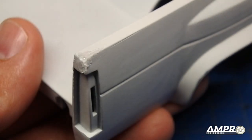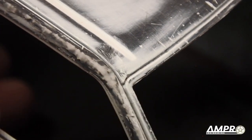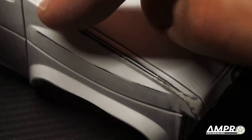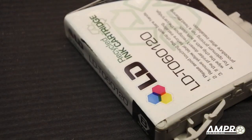We'll let this dry for a couple of days and then pick it back up and start sanding. You can kind of see here how the adhesive is basically built up a layer. The goal now is to blend this layer into the original plastic — that is the next step. What I use now is a sanding block. You must use a sanding block here: if you do not, sanding to lower this edge will only result in the plastic around it getting sanded down and causing further deformation. The super glue is incredibly hard and you cannot do this by hand.